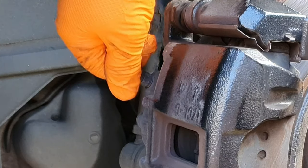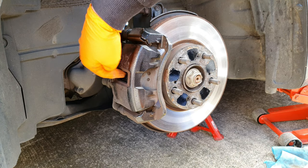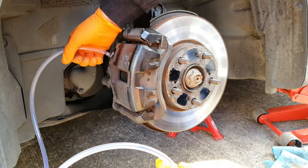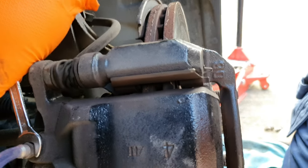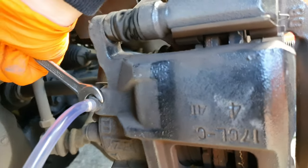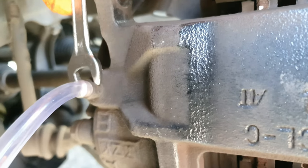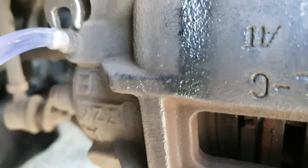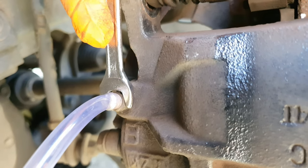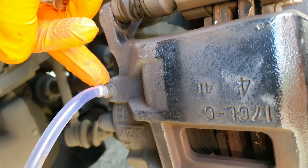All you need to do is remove this little rubber cap - it's a 10 spanner. I'm going to open it now, and when I push this in you should see some fluid coming out. There's my bleed nipple. Loosen this to allow the pressure to come out. I've tried a few times to do this and it's just not turning - my 10 spanner is winding around rather than actually loosening it off.